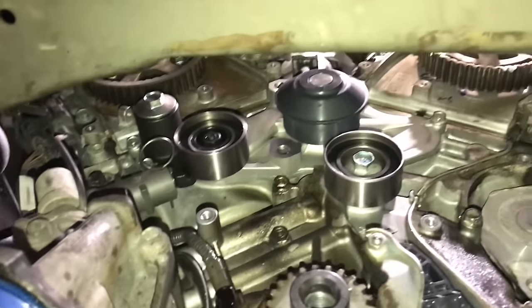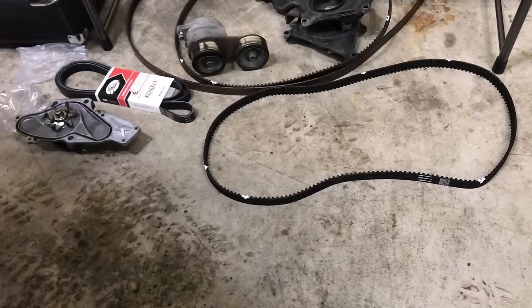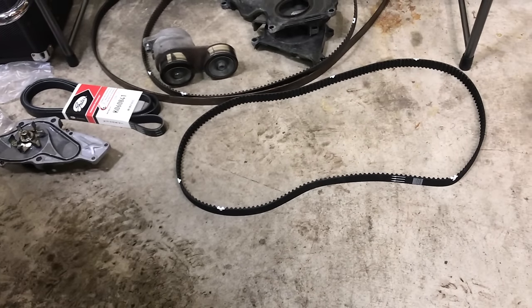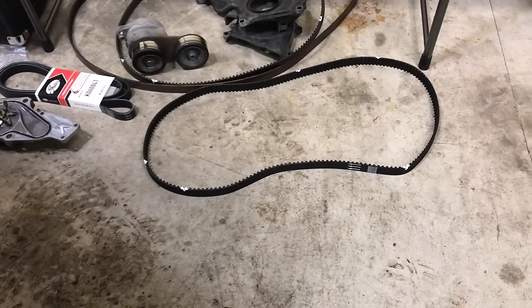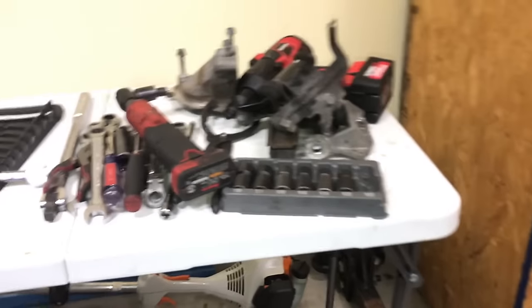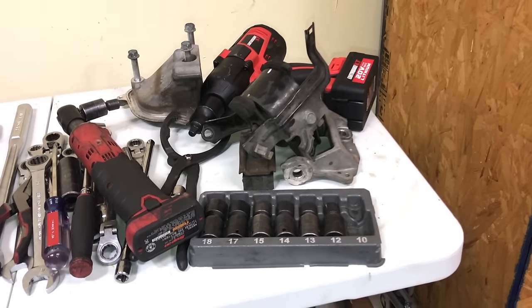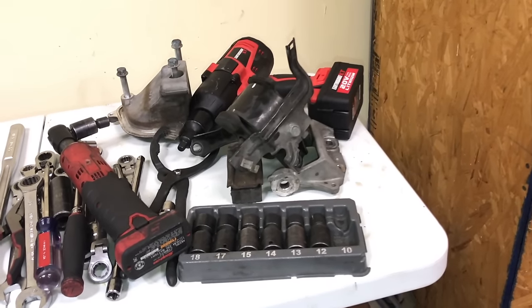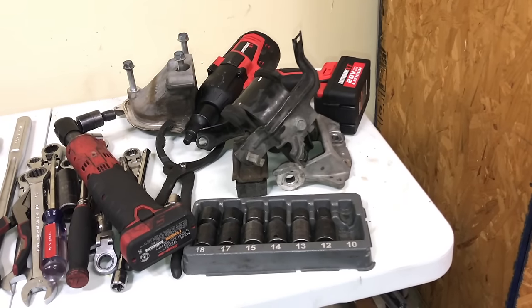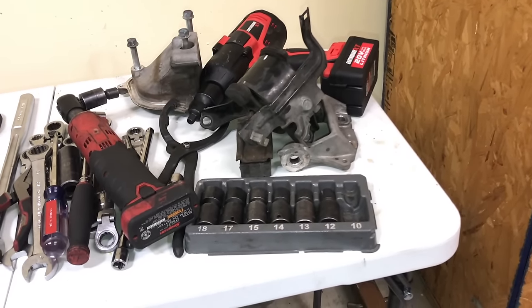All I've got to do now is put the marked belt back on. We'll put the belt back on, then rotate the crank a full 720 degrees to make sure there's no interference and everything feels smooth, then put everything back together. Up top, a few things you'll have to take off: there's the motor mount on the side and a couple of brackets. Almost all the stuff is 14mm and 10mm, so it's pretty straightforward — those are really the only sockets you're going to need.